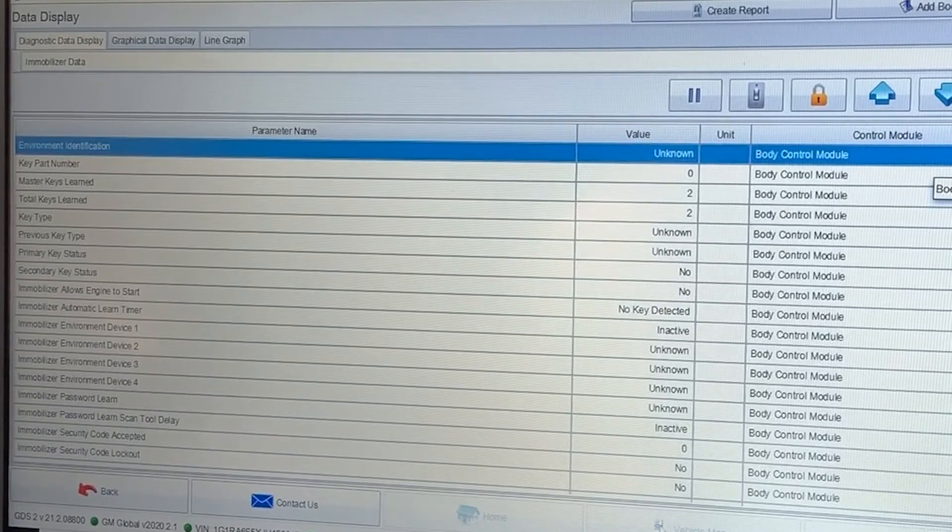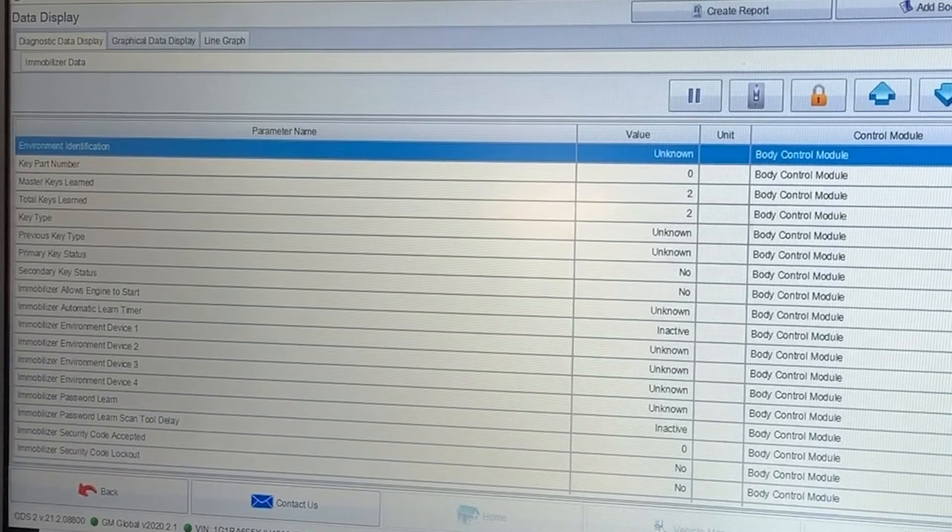One interesting thing with many cars that have a transponder key — as we saw on the dash, it will mention a pocket or a place to set the key if you think you're having issues. Traditional immobilizers pre-transponder keys utilized an RFID chip to help with this process, and most of these keys still have that capability. There's typically a special place in the vehicle, often in the glove box, where you insert the key — an antenna there excites the RFID chip and hopefully gets you access to start the car if your key has a dead battery.